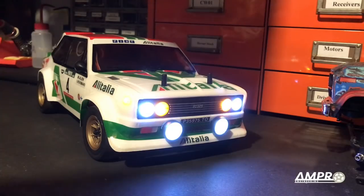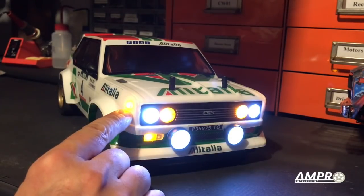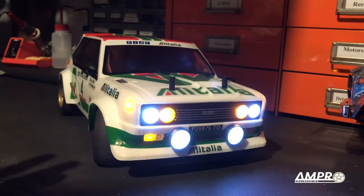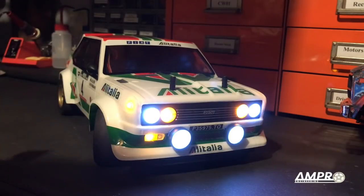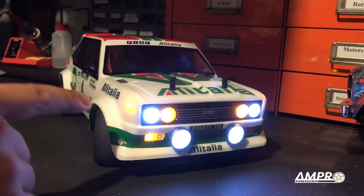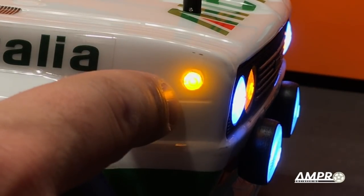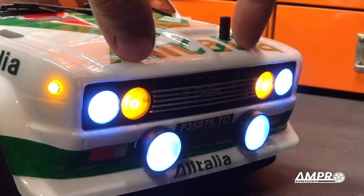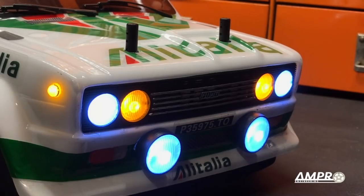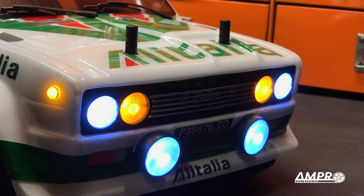Yes, there are a lot of lights there. Let's hang a right turn — left turn. Now theoretically this light should be flashing as well. European, Japanese, in fact most cars other than US-specified cars would usually have this side marker as a repeater. These aren't usually turned down unless you're in the United States, where you would have a dedicated marker on the side which stays on. But this really should be flashing — I just don't feel like chopping up the wiring to get that to work. This came out a lot better than I thought. I had backed the entire inside of the fender in several coats of silver paint so that you're not getting a glow, and it really came out nicely. In the front of the car I did go with the yellow lights on the middle of the 131 grille. I'm uncertain if that is how any of the rally cars were, but I've always been a fan of cars with quad headlights having the insides in yellow — they look a little orange on camera but these are actually quite yellow.